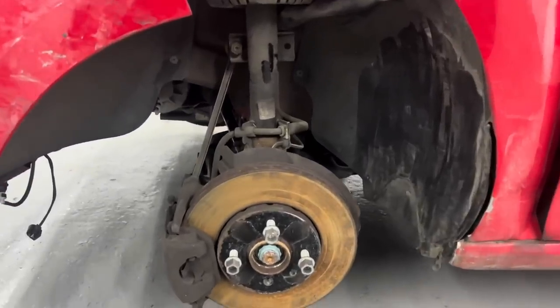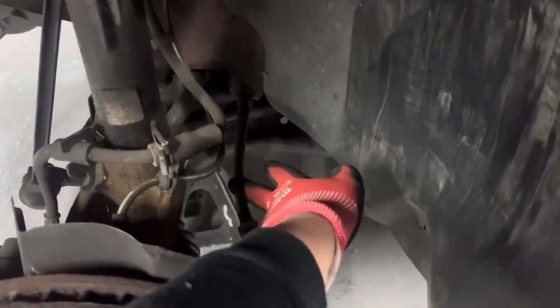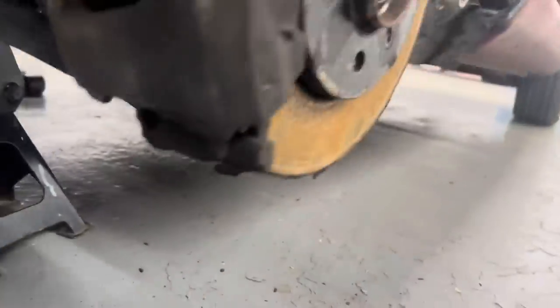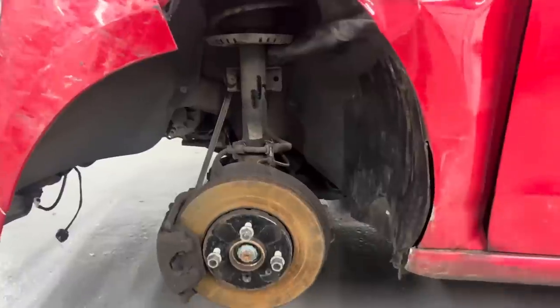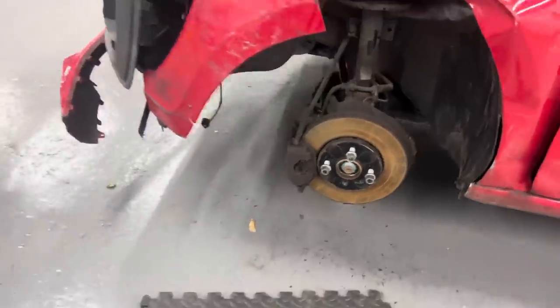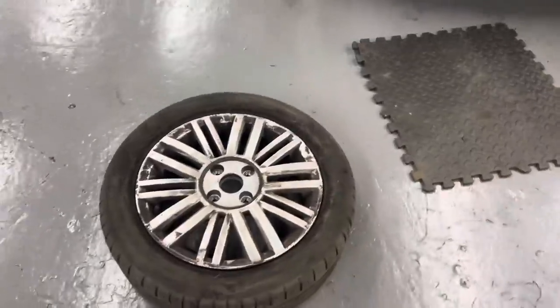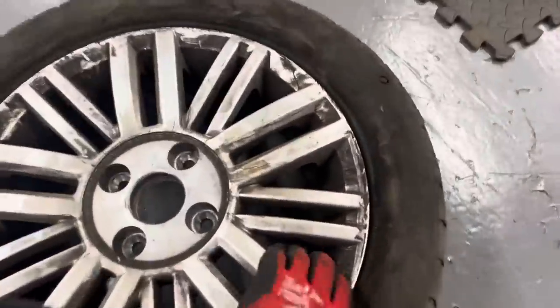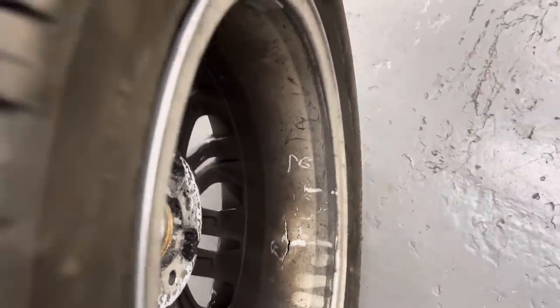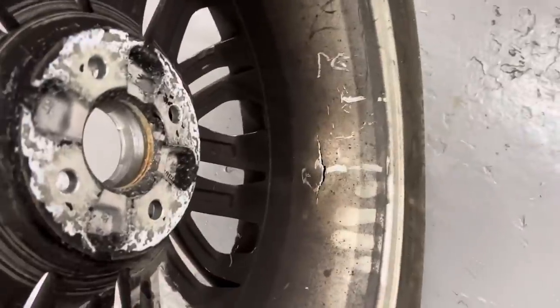Apart from that I have seen some damage to the suspension. The tie rod which goes into the tie rod end is bent like a banana. The wishbone is twisted, so that's all bent up. I'll be replacing the whole suspension on this, but I won't be taking it off today as the new suspension is at home. The alloy wheel — when I turned it around you can see it's split the rim. All that force when the wheel got pushed back split the alloy wheel, so we're going to need a replacement wheel.